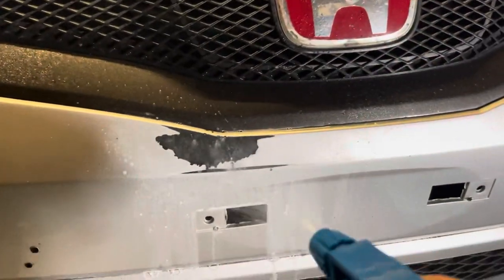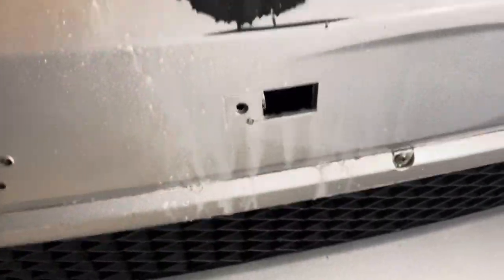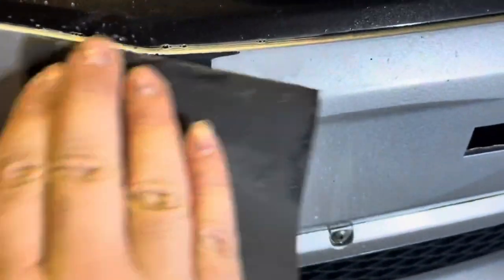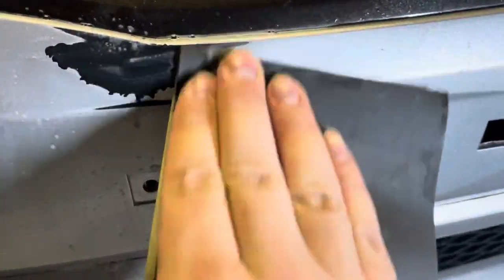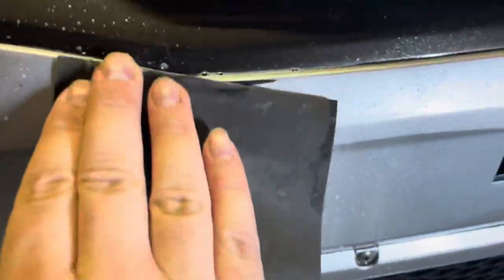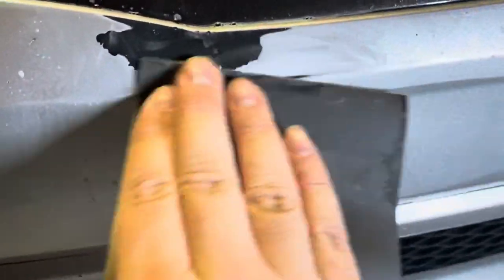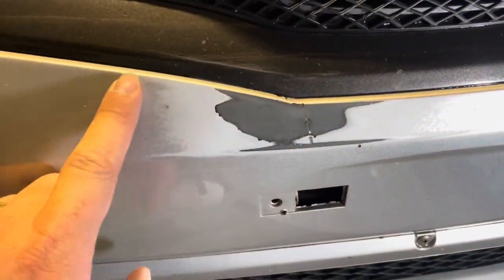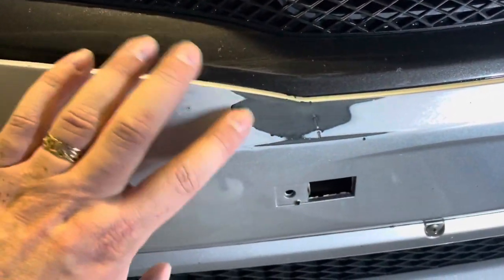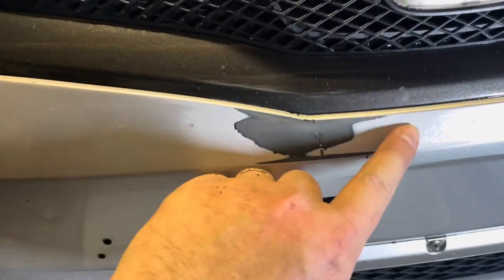The main thing is just to make sure there's always a kind of lubricant layer between the car and the sandpaper, and just alternating the motions between back-forward and up-and-down, just to make sure you get as smooth a surface as possible. So that's me sanding it down - it's really smooth to touch, no real bumps or edges from the paint.